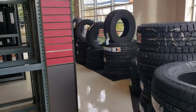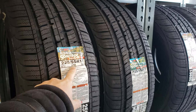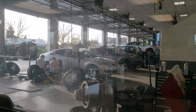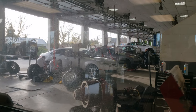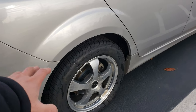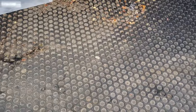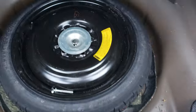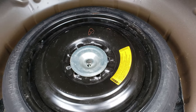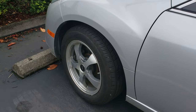It looks like they are going to replace that pierced tire with a Cooper Road Control 225/55/17. They put on a brand new Cooper Road Control and removed the undersized donut — it was actually bent, so they had to bend the rim back before they could fill it with air. The fill is 60 PSI as recommended. That's my spare, so that's good to go. They torqued the nuts and now all four full-size tires are on. We are good to go.